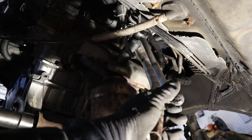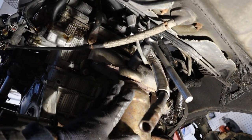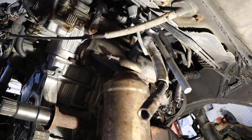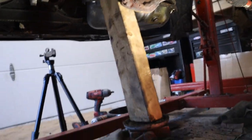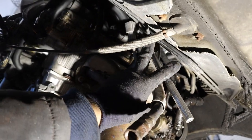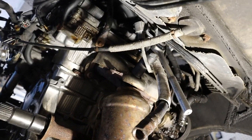Meanwhile, I am taking the opportunity to change the O2 sensor at the back here — we had a P0031 code for it, which is for the heater sensor. It is a very difficult job to do with all that stuff in the way. I had to jack the engine forward so that it swings away from those brake lines, and I really don't know how you would change this sensor if everything were still in the car.